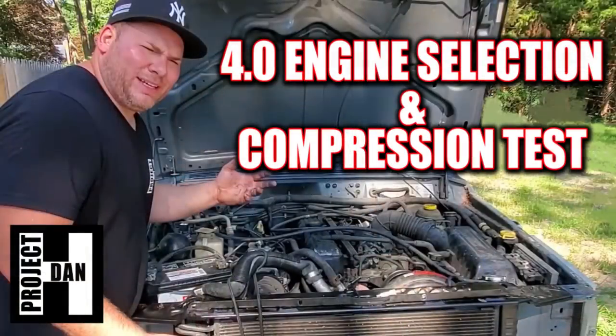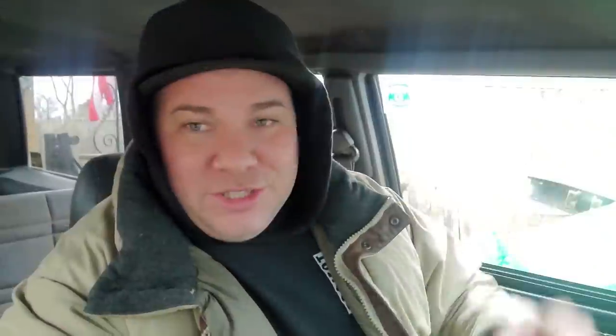My father and I acquired the vehicle from him. Square one, we wanted to make sure the engine wasn't seized. We put an 18-millimeter socket on a breaker bar and cranked over the engine from the harmonic balancer nut in a clockwise position. It moved nice and free, so we knew the engine wasn't seized. Next thing we did was a compression test. We got good results - good compression - knew the engine was in good health.